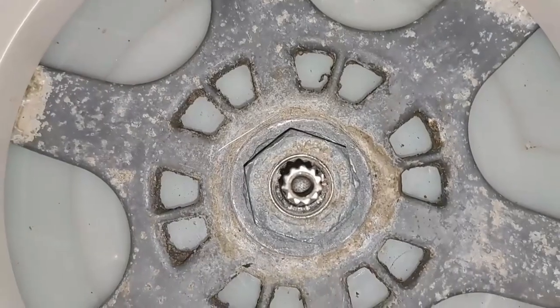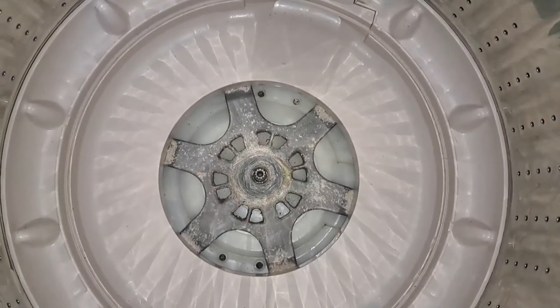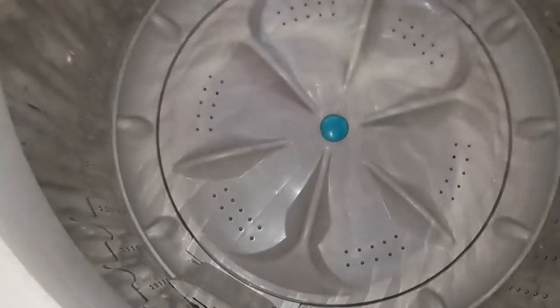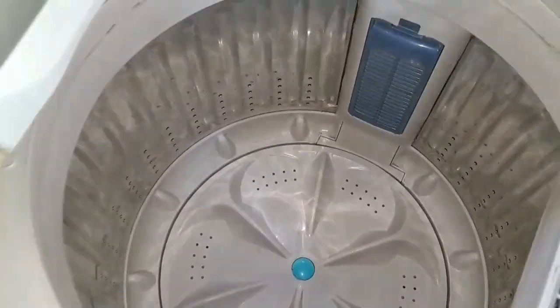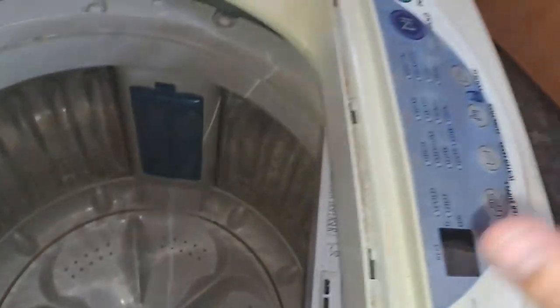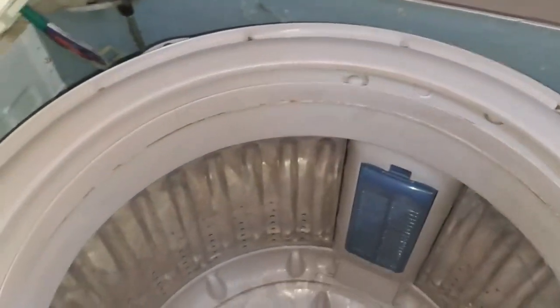I made this nut as tight as I possibly can from this angle — I only have an adjustable spanner, no socket. I proceeded to put the agitator in first because I forgot about this ring. This ring has to go up over here, so before we tie this down I have to put the ring back. The agitator fits perfectly — I was able to fix the splines. So now I'm going to quickly wash this ring, put it back, then close up my panels and everything. The ring is in, tightened down with four screws — one, two, three, and four. There's the whole drum assembly in place.